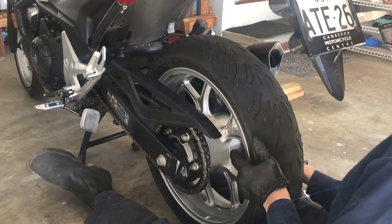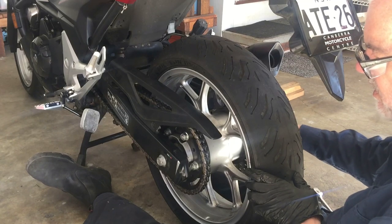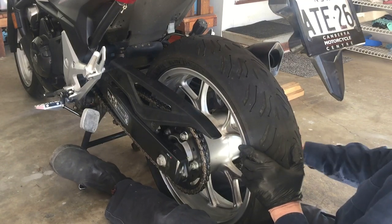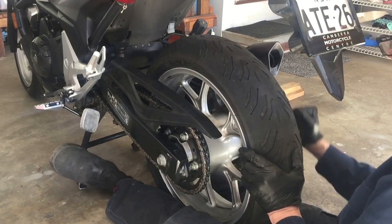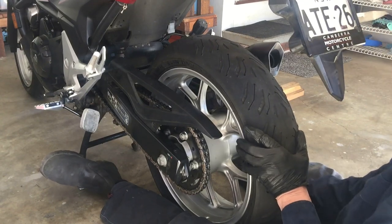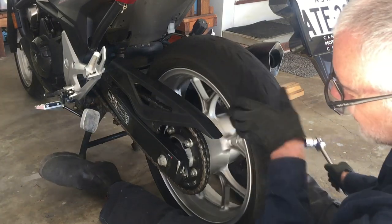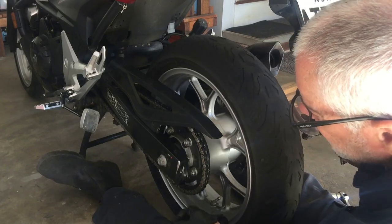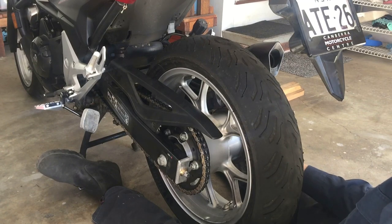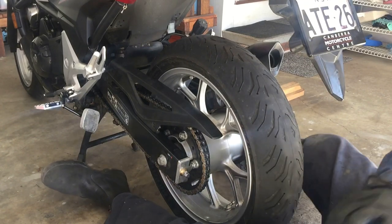Because the chain tension adjusters haven't been moved, just force the wheel forward to make sure those adjusters are in place. When you tighten up that axle nut it has a tendency to pull the wheel back on the right hand side, so you've just got to be careful that you keep some pressure on the wheel so that it doesn't slide back and put the adjustment out. The easiest way to tell is when you finish, all the adjusters should be tight rather than rattle. So once I take that tape off I can just test that to make sure they're not going to rattle — it's all good. There's another little maintenance job done, thanks for watching, catch you next time.